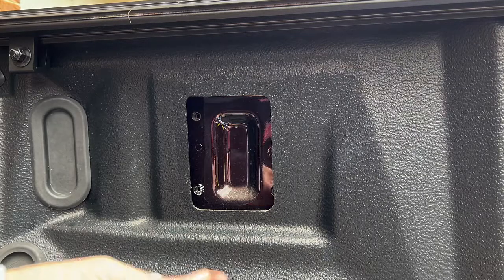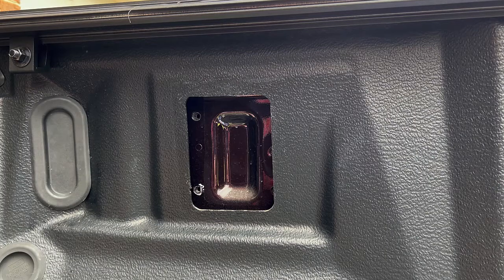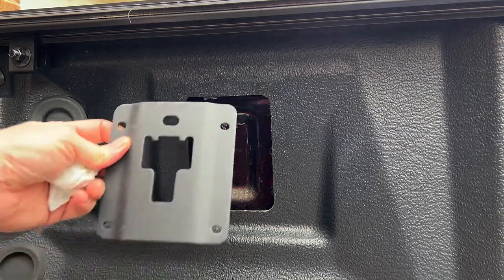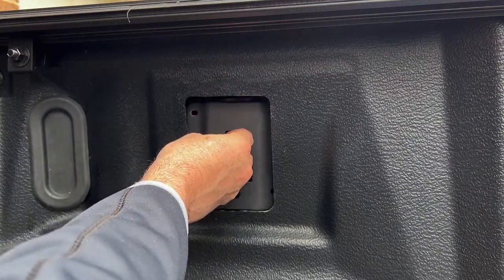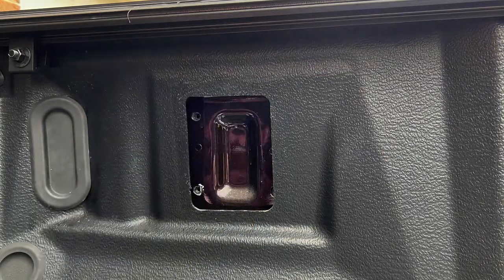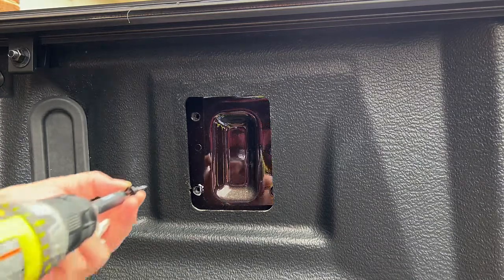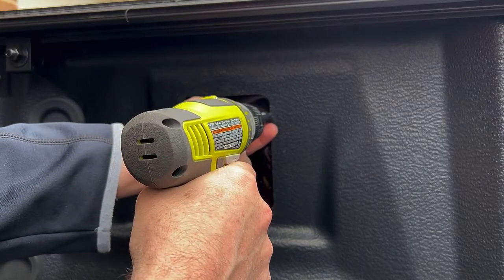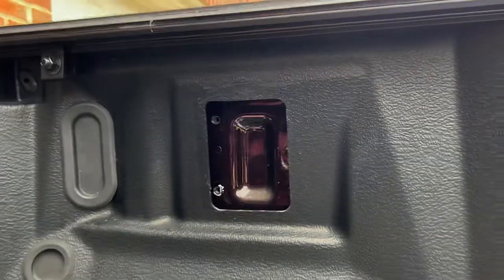One of the very cool things I noticed about the Ronin kit is the screws — they actually give you four extra screws and an extra Torx bit. So there's a second bit, so you're good to go, and we've got two extra screws. The way that these go in — remember that is upside down, we want them to go in like this. Here's kind of where it's going to get a little dicey because this could fall behind the liner. That's how it's going to sit in there — it makes it look like a little rocket ship taking off. What they recommend is you first go ahead and drive in some of these screws in order to establish the threading for the holes. This bed liner does come out quite a ways and kind of gets in your way where you may want to trim it back. So I'm going to grab my Dremel tool and do that right now.